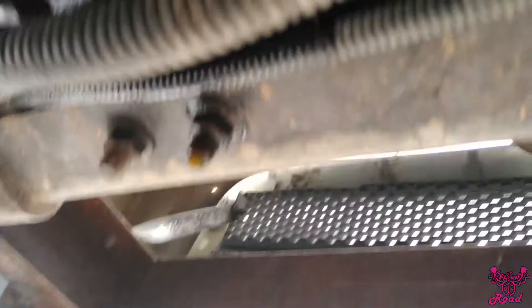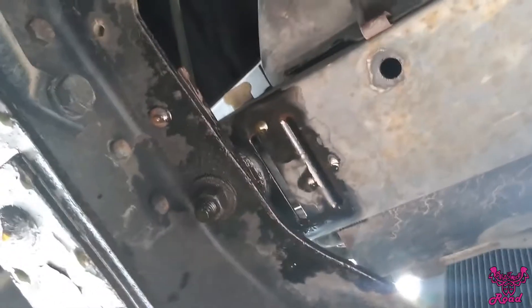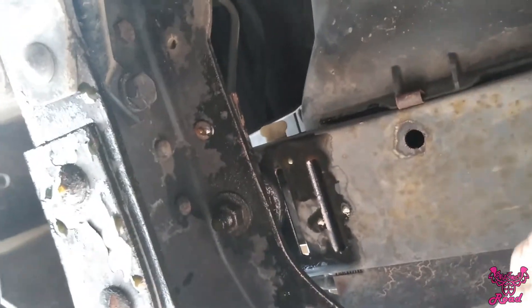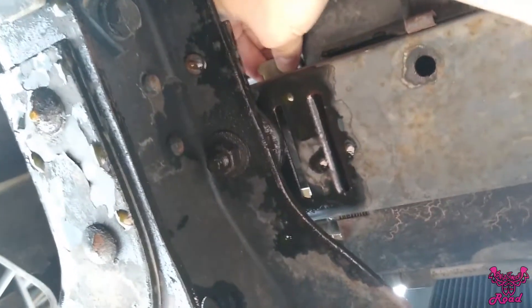Back under here again — now we've got all clean water inside that is going to be flushed out once again after we let it run for 15 minutes. We let the motor run for about 15 minutes with the new water inside and we're going to let it drain by pulling this petcock out.